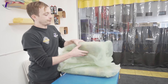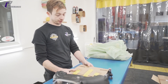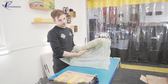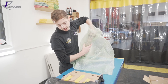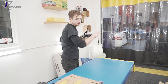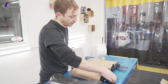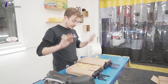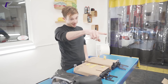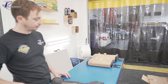The 750 kit on the Gen 1 used to run a radiator pack in front of the main radiator behind the front bumper. On the Gen 2, there are additional radiators or coolers in each blade. What this kit does is utilise that positioning and runs these radiators in each blade. There are some really nice little embossed brackets to hold them, and these sit in each wing. Then we route through the charger, through the pump, through one radiator, across to the other side through the other radiator, and then back up to the header tank. So it keeps it all packaged right at the back of the car, whereas before we had to run pipework all the way up through the prop tunnel — we haven't got to do that now.